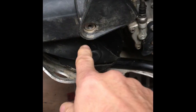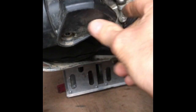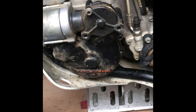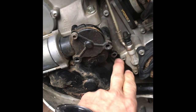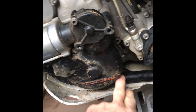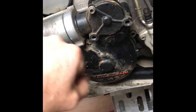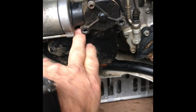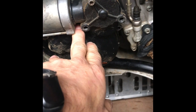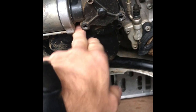You've got this plastic cover where you have to undo three bolts just to get it off and access the bolt behind it. Plastic cover comes off and you're left with the sidecase. Once you've got that off, you can get that bolt out. So you've got one bolt there, one bolt there, another one round there, another one round there, one down there, and one tucked up behind here. And finally there's one up under there — it's right up under there, easy to forget. If the case doesn't come loose, you've probably forgotten that one.